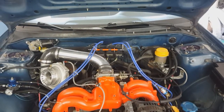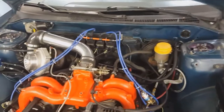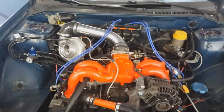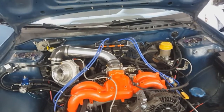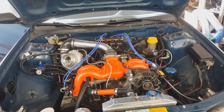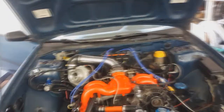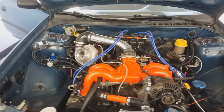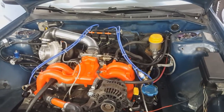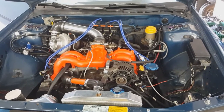The point of the car is to be light, and by being light it doesn't need a lot of horsepower to go fast. It is a stock five-speed transmission, cable clutch, with an Exedy lightweight flywheel and Exedy clutch — not even sure which clutch it is, it was in the car before I bought it. Really with this car, everything on it is stuff I either had laying around or acquired through trades or massive discounts — it's just kind of built as it comes. When I had the opportunity to pick up this turbo kit I did, threw it on there, not really with any rhyme or reason but just because I can. The nitrous kit, a lot of the fuel system stuff, the coil packs — all had from other projects.